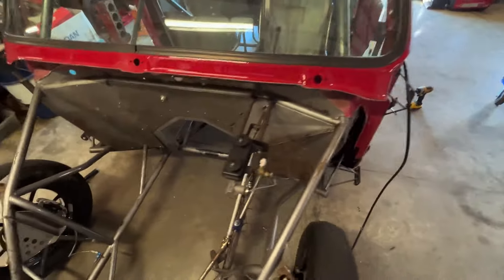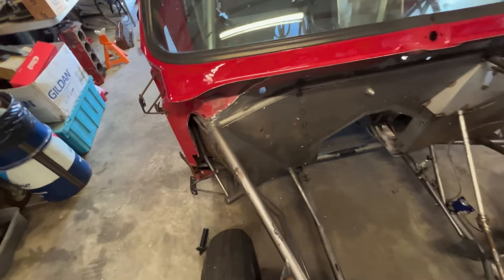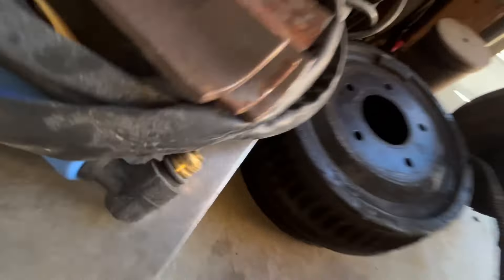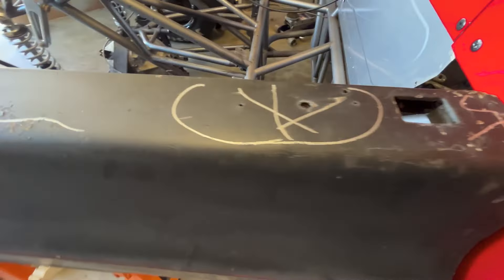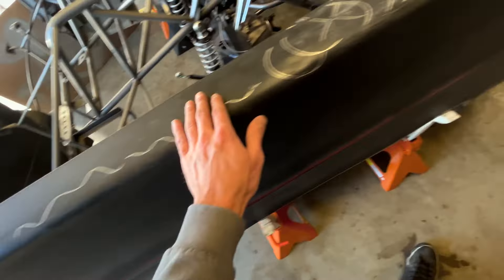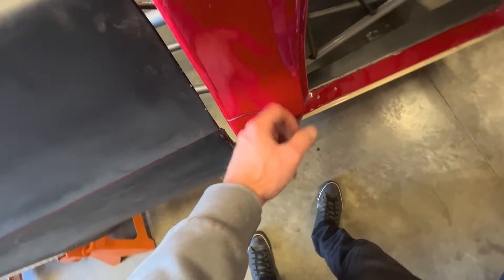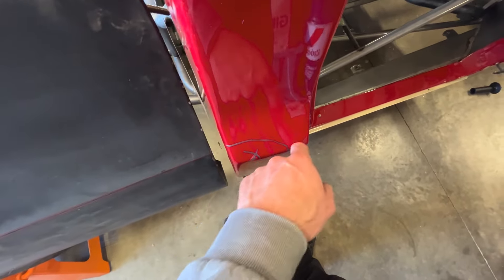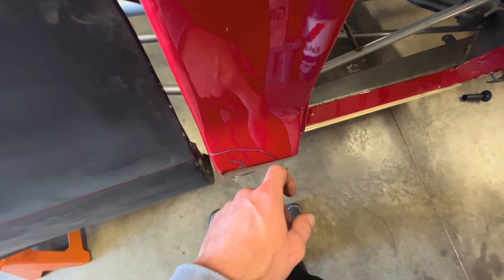That's what we got going on today. It's a nice day outside — we're working on them freaking hot rods. Oh yeah, I got the firewall smoothed up a little bit. Took that grinder to it. We got it cut up in here. My air's being janky, but we still got to cut all this out. We got a plasma cutter over here — I might go get a tip for it and just hit it with that plasma. Pops marked a bunch of stuff last night that are major must-fix items on the bedsides — a little wavy here, a little wavy up there. When we did the cab, it was kind of a rush job, so we got some bondo work to do. This area protrudes out and slants in, so we're going to want to fill that in a little bit.